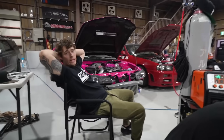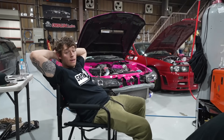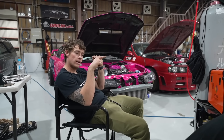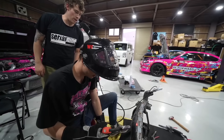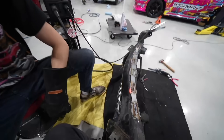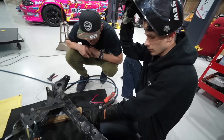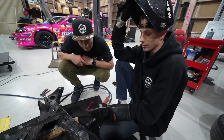I forgot to clean this round — I just blew some air — so it was welding really dirty and sucking, so Sam's tagging in for this one. I did learn a lesson though: you're supposed to tack them in and then hammer them down so they're flat. I didn't know you were supposed to hammer them, so this one was grazed a little for a couple welds and we had to bridge it. So Chris just tagged me in and I started welding in the gussets to try and get this done faster, and I flipped over the subframe and found this. This is a huge crack — this is one of the big issues with these subframes, which is exactly why we are reinforcing it right now. It's just what they do. In time, this whole piece will snap in two.